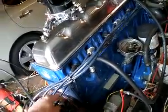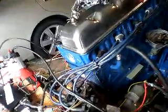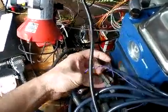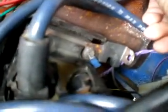They plug into the old coil pack here. This in turn is hooked up to, if you look carefully, there is down there a capacitor. Let's see if we get down there. Yep, that's a capacitor which is going to ground, which helps eliminate some signal noise.